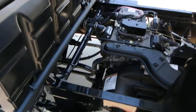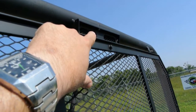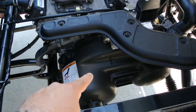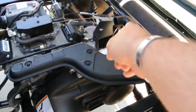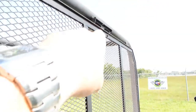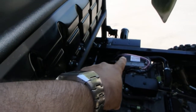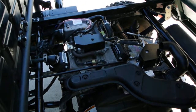One of the cool things about the Mules — right up here on this cage is your air intake, and this is a snorkel air intake. Kawasaki intakes the air right up here. The air comes down this tube and you can see there's a hose connected here. There's a filter in here. This one is for the torque converter — that's your transmission and this is a belt drive torque converter. We circulate air through that torque converter to keep it cool, so it has an intake and an exhaust. We filter the air we circulate through there, and we snorkel up high to get cleaner air since there's less dust up high. The same thing on the other side — a hose goes to the air intake on the motor. This really adds to the life of these motors and torque converters, especially in a dusty environment.